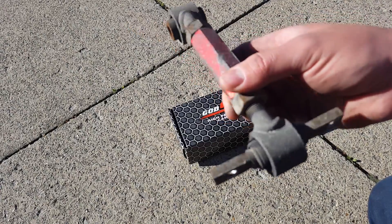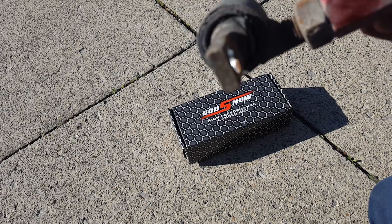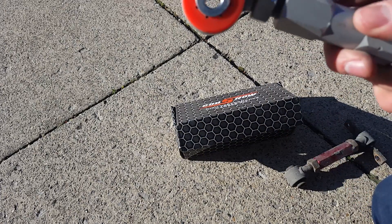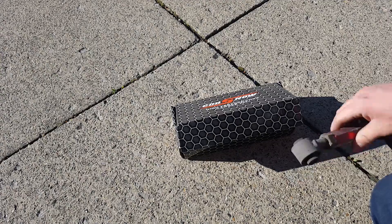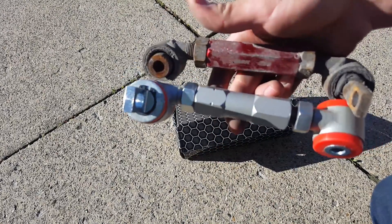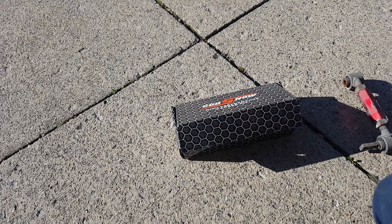Here's the old one. You can see this bushing is a little bit blown out - not too bad, this one's still good. The other side's completely blown out, that's why I'm changing these. These are the same brand - God's Now or God's Snow, whatever you want to call it - just cheap eBay stuff. This one, however, is different. They're around the same price, but this one has replaceable poly bushings. So when these go out, I can just replace the bushings with some Skunk2 ones. Whereas the cheap ones just have hard rubber bushings that obviously blow out really easily. This one actually feels a lot better. These lasted about two years, so not too bad - definitely not worth spending $220 for Skunk2 control arms when the cheap $30 ones work.